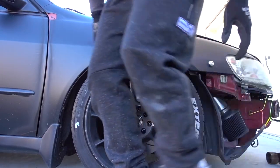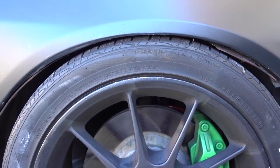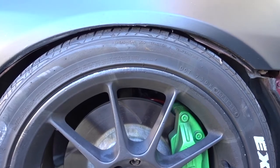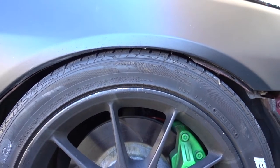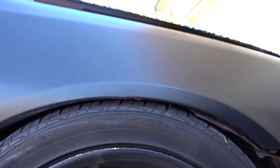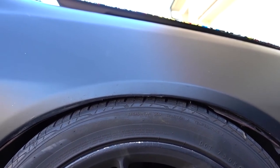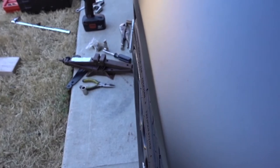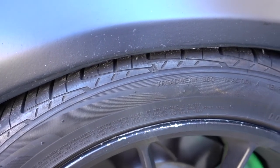See that right there — that's what I'm looking for. You can even put your finger in there. The coilover has to settle probably a little bit more. I'm gonna see how it looks and how it drives because I haven't driven the car yet. Later on I'm gonna drive it around and see where we are. That's how you adjust the height on coilovers — super easy to do. Right now it sits where I wanted it to be. I'm gonna do the same on the rear, but the rear looks really good right now. I have a 20 millimeter spacer and it's just right.